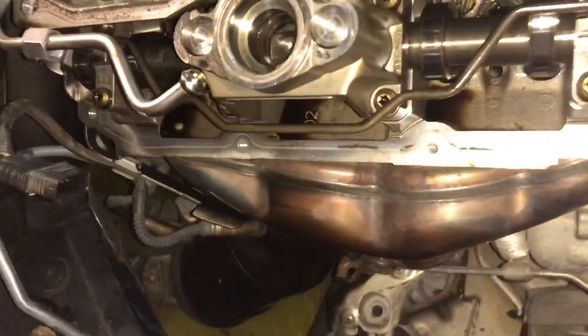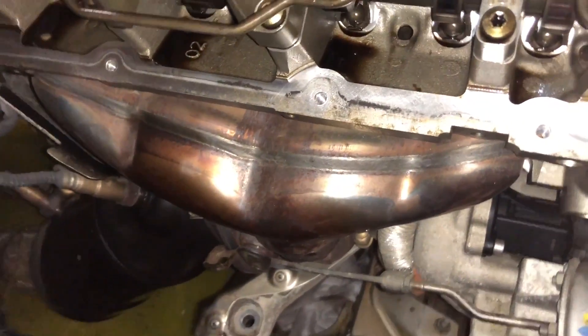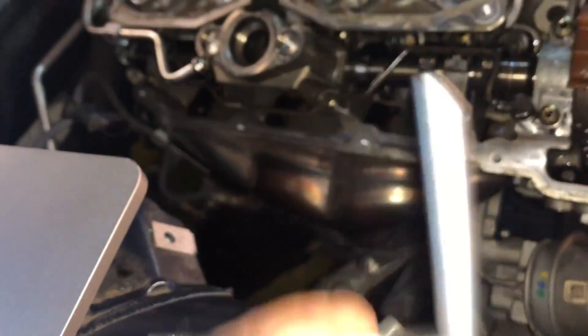In order to do so you have to have your flywheel locked, so there's a special tool that locks the flywheel. You should also be using this little tool to lock it. However, I can't get in there — I would have to remove basically half of the exhaust pipe and all that stuff in order to install it. So I'm gonna just use the positioning from the bottom. Hopefully that's gonna work for me.